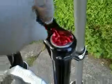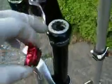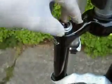And then we've got the 27mm socket to undo the top of the stanchion. So that's that going. On the other side we've got the ATA adjuster, that's the travel adjuster. That should just pull out as well. Just wiggle it, and then it comes off, and then the standard Shimano cassette tool will fit in there and undo that. Right, so I'm undoing the top cap.